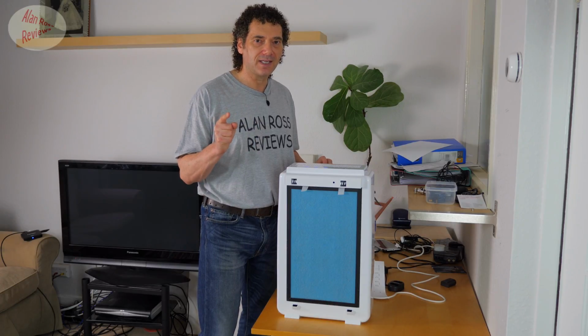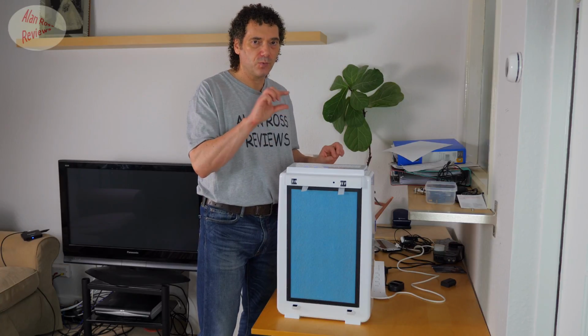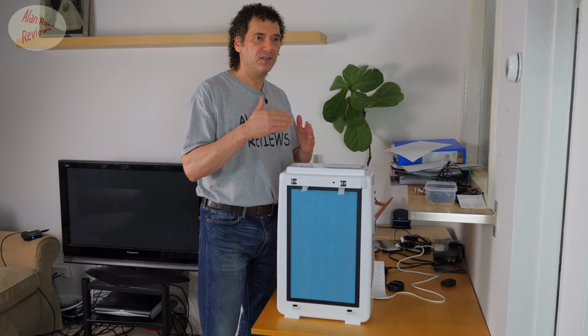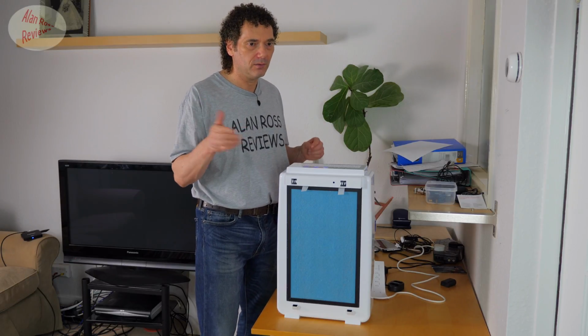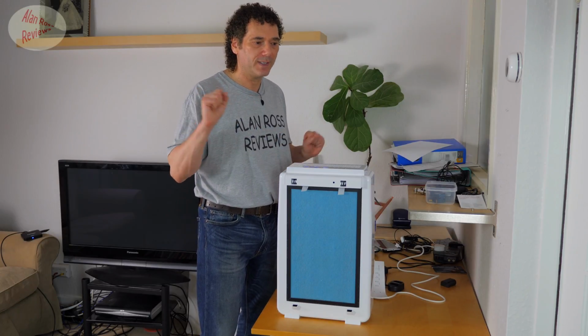If it doesn't say cubic meters per hour, then technically it should be rated at cubic feet per minute, which the actual number would be lower. And that's my issue with the Pro Breeze. They interchangeably use 218, sometimes with the cubic meters per hour quoted and sometimes without. That's when it's misleading, because without that at the end it should be quoted as 128.